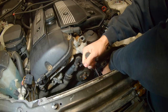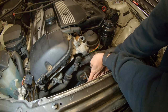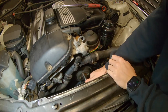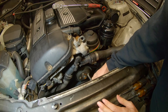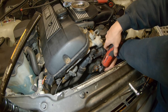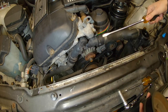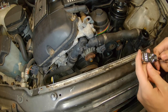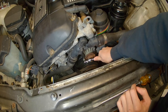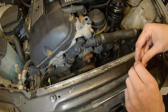I just want to take the belt off real quick. I definitely should have gotten a new belt but I forgot. Should have loosened that before undoing the belt. There we go — now undo the bolts. Keeping the belt on but off the tensioner is definitely the way to do it. Just giving it a little twist behind the pulley, persuading it off. Now I can come in and take the water pump out. With the bolts for the water pump pulley, just throw them into the actual water pump to push the pump out.